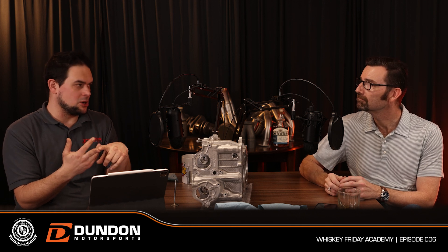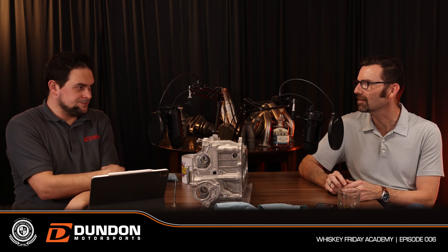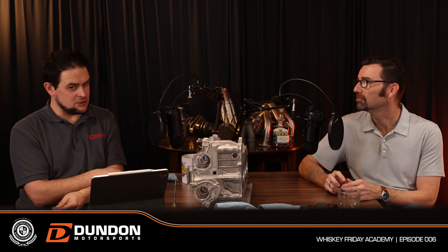Most pumps nowadays — pretty much every water-cooled Porsche 911, Boxster, whichever — have mechanically driven pumps. They vary the speed, but they're not electronically variable. The water pump speed on a Turbo versus the GT3 is different because the GT3 is meant to live at 6,000, 7,000, 8,000, 9,000 RPM. The pulley size on the Turbo is actually different — about 15 to 20 millimeters smaller. Newer Cayennes, Panameras, and such are all electric water pump. Those are more daily driver, not motorsports driver — SUVs and Panameras. If electric were clearly the way to go, they'd probably apply those in the motorsport world, but they're not doing so.